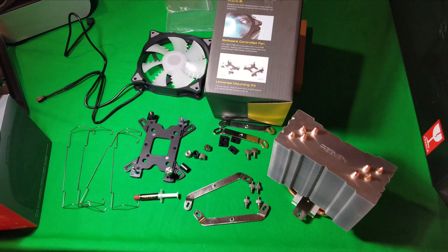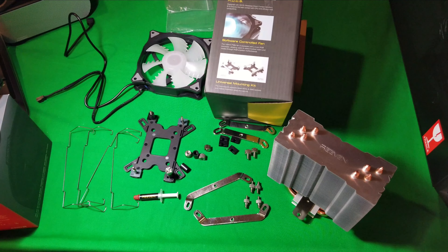We're doing an AM4 install. Right now I've taken everything away we don't need — this is everything we need for the AM4 install. We're going to put this on the back of the system. Of course this is going to be the part going up through the holes in the back of your motherboard. You'll know you got it the right way because the indentations here are for if you're doing an Intel install. Our next step is to remove the stock cooler that I already have on, so I can prepare everything to put this back plate on the system and get everything going.